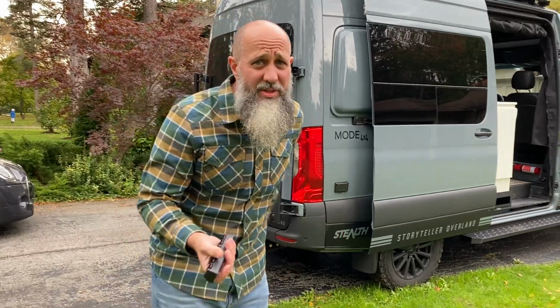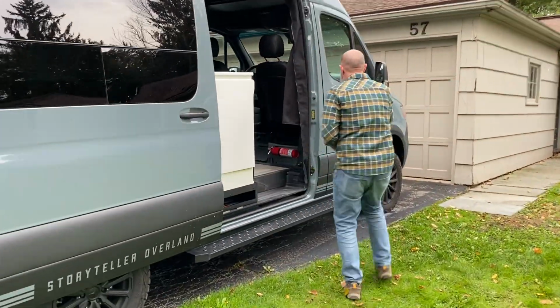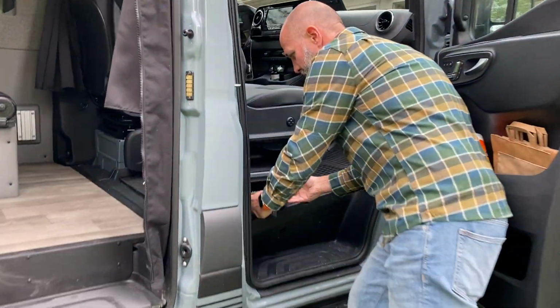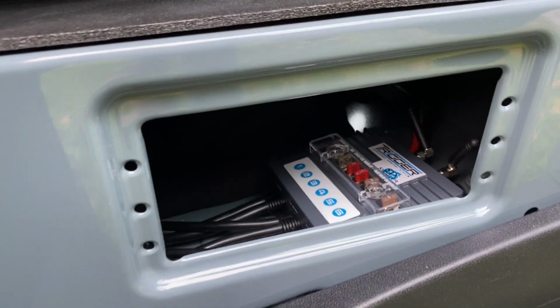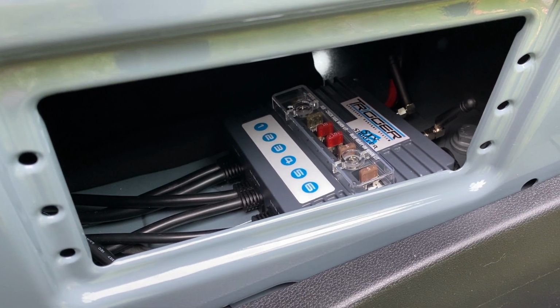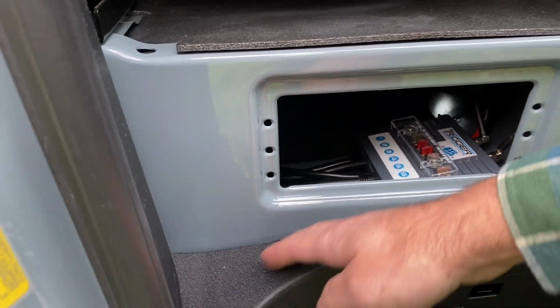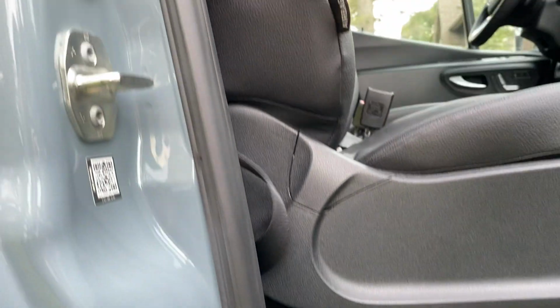So we're really happy with the trigger system. We mounted everything under the seat here, under the passenger seat. So the 6-shooter goes right here. I did change out a couple fuses to 25 amp fuses to work properly. All of the wires come over through here under this little compartment. You can kind of almost see them a little bit. And then they come up the passenger side pillar from the other side. And then let me show you where they go from there.